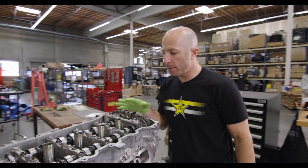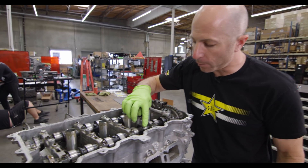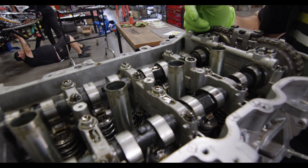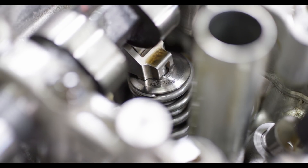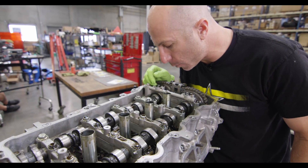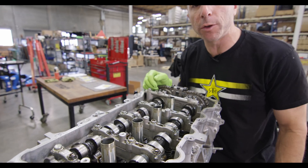This engine actually had a head gasket issue, and you can see some condensation on the cams — water is condensating inside here. And this retainer doesn't look super healthy. It's definitely good we pulled this thing apart; there's probably some stuff to look at in here.